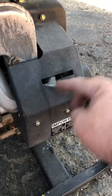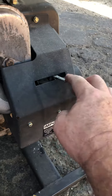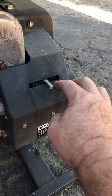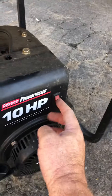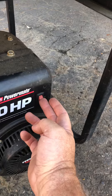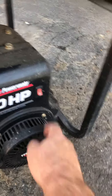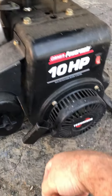This is your choke. This is fully open, this is fully closed. We're gonna start about halfway since we already had this thing running for a little bit. And this is your on/off switch for the electrical and for the motor itself. We'll put it in the run mode, which is the line being pressed in, and then I think we're ready to start.